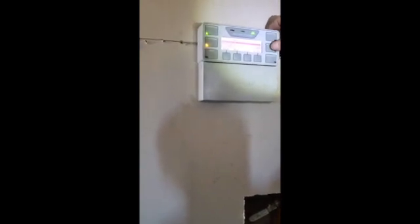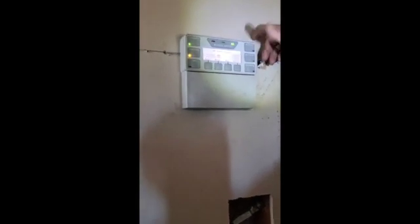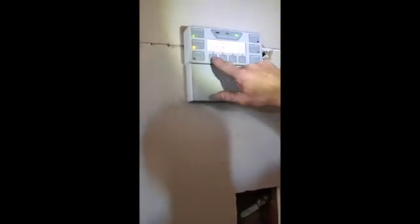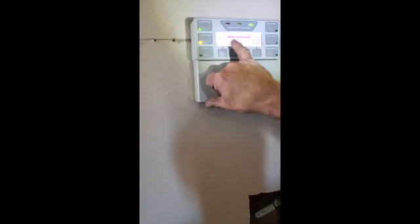So there's nothing here. Our AC input generator is not on, so the input state is dropped, is not in use. And if it was, then we would see 125 volts, 60 hertz. So those are no longer. So we'll go back to this. We can see now, because the solar's working, here's your batteries right here, and it shows in this black grid how much power we have. So we got 0.4 kilowatts now set up, and our battery source is at 51.2 volts.